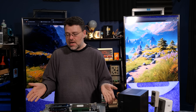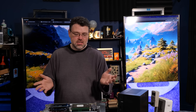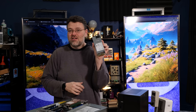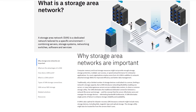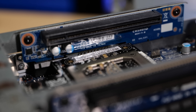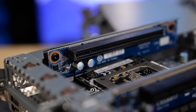In this case, because edge compute is not really meant for local storage, this design is about high availability. We do have redundant power supplies — two 1200-watt 80 Plus power supplies that are tiny, weensy little power supplies. For a high availability configuration, this would also be used with a SAN, a storage area network, meaning your virtual machines and everything else would be running out of SAN. So you really would use your PCIe connectivity here for everything up to and including InfiniBand — this is basically how you connect your disks.